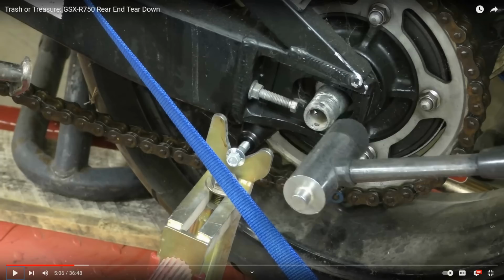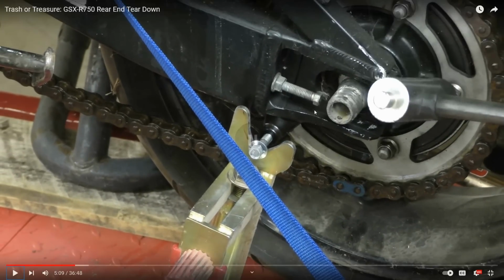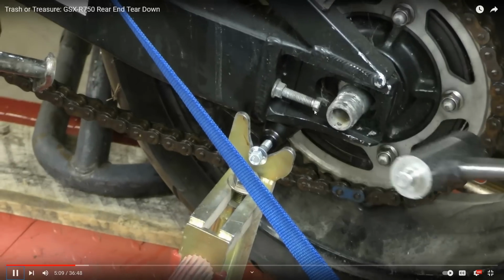Also, put the nut on it. You turn the nut the other way around and just get like 3 or 4 threads on the nut. Get a crack on the back of the nut, in getting this axle completely out of this. The other thing as well is, because of the adjuster, it's all the way to the back. So, because you've now taken the adjuster off, give the tyre a kick towards the front, hold the back of the bike, and just boot the tyre and it'll free it up a bit, to get the wheel off.